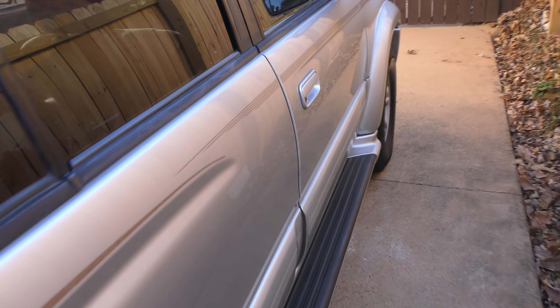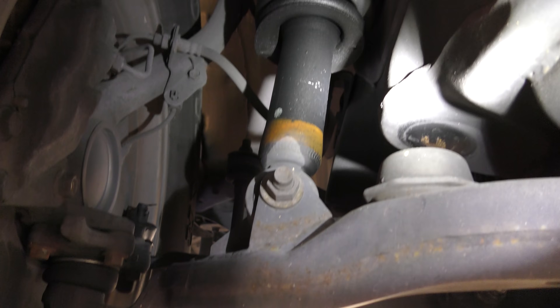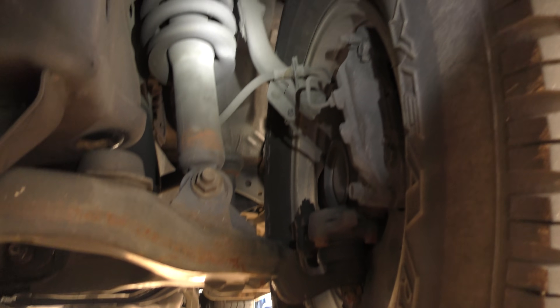Now let's move to the front. As we look under here, you can see it's all wet — this is all leaking fluid. This is like a combo shock and spring, almost like a strut, and that one is starting to leak. Looking at the other side, it's relatively dry but starting to seep a little on top. When you change these things out, you want an even ride — buy quality replacements and buy them in pairs, because if you have one style on one side and another on the other, who knows what squirrely things might happen to the handling. I like KYB; you get what you pay for if you shop around correctly.